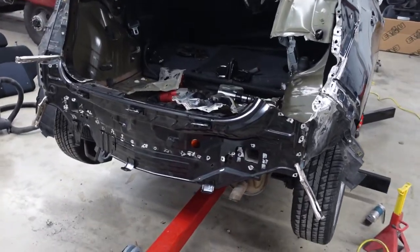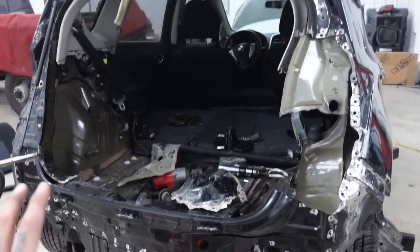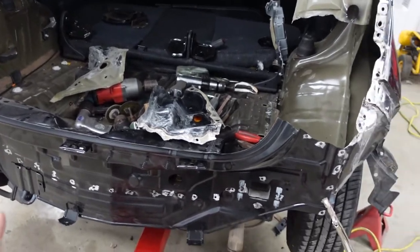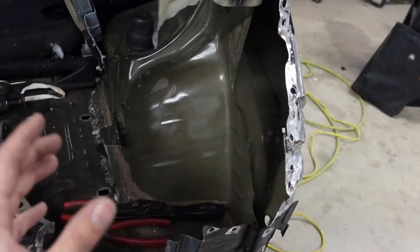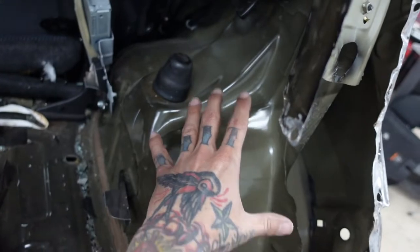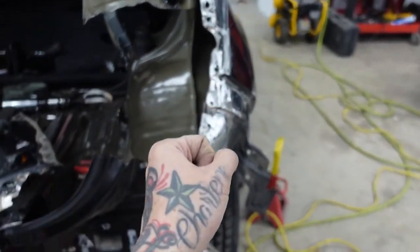All right, guys, I got my rear body panel sitting on here. It's clamped down here in the corners. I don't want to go too far with this until I get my hatch on and get it all latched up to make sure it's all fitting properly. I'll put my seal in it, make sure we got really good gaps in here and it's all sealing up for us. I got the inner wheelhouse all pulled out. When that all got smashed, it buckled all this in through here. So I had to get all this cut out of the way to make them pulls on that.